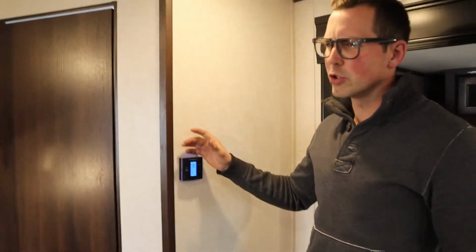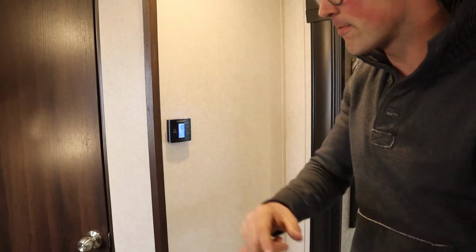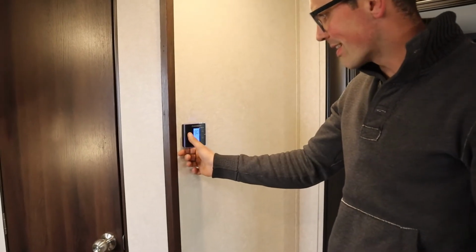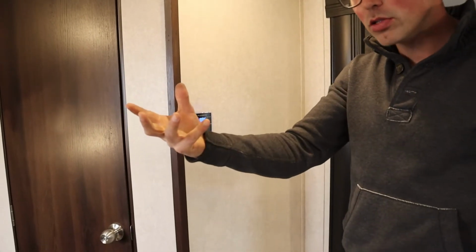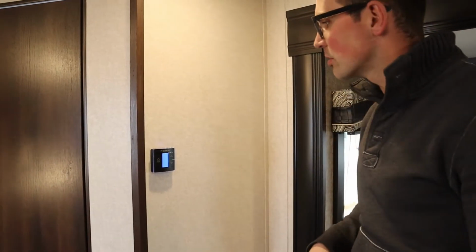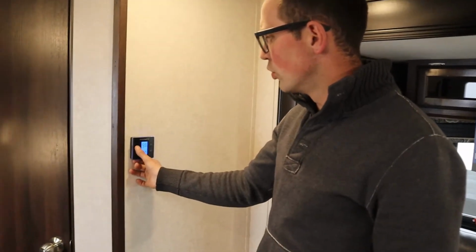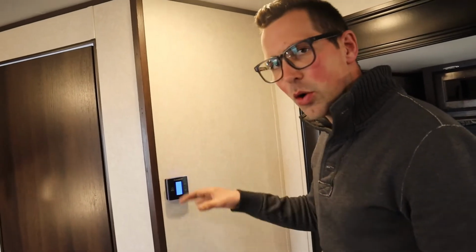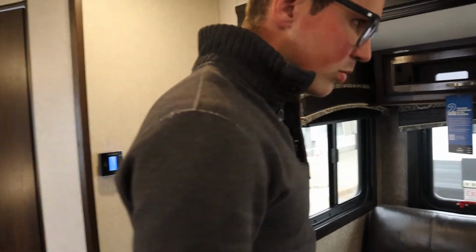Sorry about that. So on the outside of the trailer, you're going to hear the fan come on, and then you're going to hear click, click, click, click, click, and then the roar of the flame from the furnace. After I push the mode button again and shut it off, the flame on the furnace will go out, but the fan will continue to blow, just to blow the excess heat, any propane that's left in the system, anything like that. So to refresh that, you have 3 modes: fan, cool, or furnace, and whatever you selected within those modes is going to operate at the time. Cool.